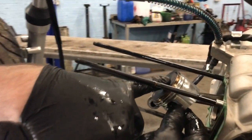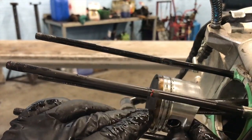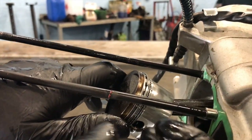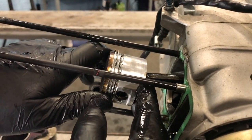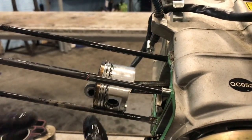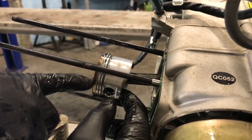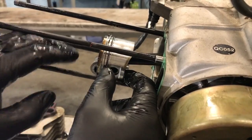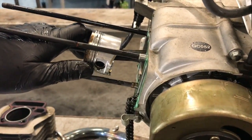On the head of the piston, it's got "IN" written on it, so that obviously points towards inlet. So when you're putting in your new piston, with two strokes it's really critical because the rings have to go past intake galleys and stuff in the bore. But in a four stroke, it's obviously not as important. They normally have a little ridge where the rings have to sit. You've got your compression ring, then an oil scraper ring at the back, and then there's two rings in that, which picks up the waste oil and slides it back down to the bore.